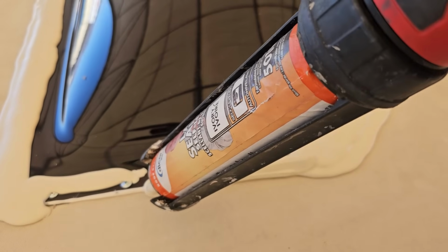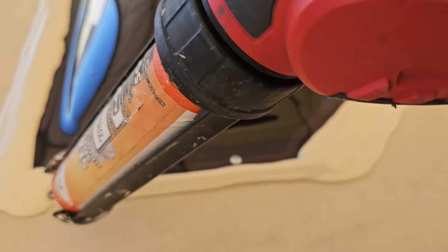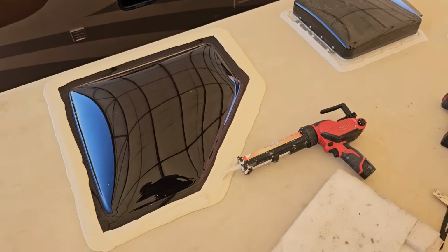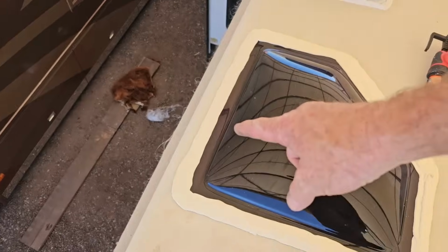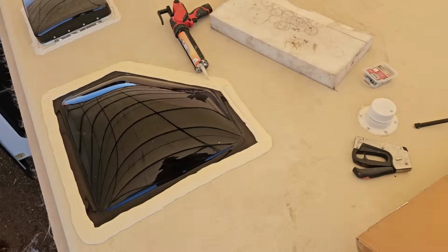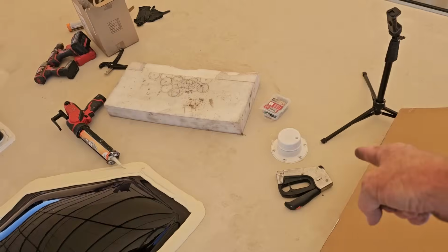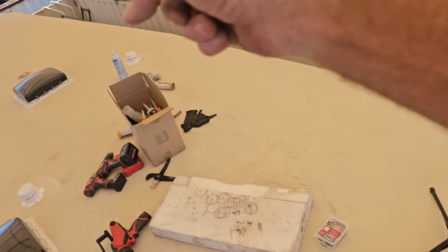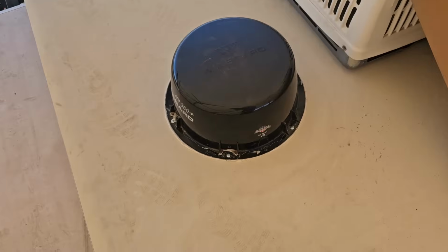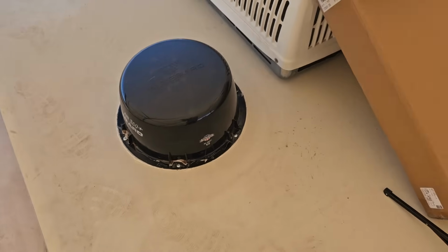It's self-leveling. And I think at that, the skylight is installed, and I think if you guys remember before, the sealant was actually going over the radius, so we didn't do that on this one either. So I think that looks pretty good. I just have that sewer vent to do there, that sewer vent, that sewer vent. We've already done those two vents together. And then I did install a Winegard Air 360 for the TV antenna. So I just need to seal those up with the same lap sealant.